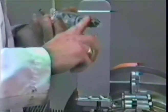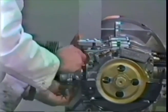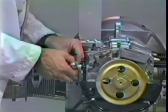The C912 pump is a much simpler pump and therefore lasts longer than the B or A type pump with all the monkey motion. Simply feed the pump in, push it so the seal goes through. And you can use 12 or 13 millimeter nuts. I like 13 because you can always use a half-inch wrench on it. If you use 12, there's not much American wrenches that are out in the boonies you can borrow. Put the 13 millimeter nuts on.